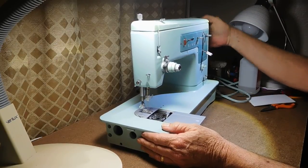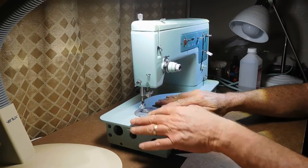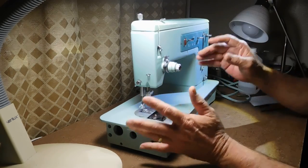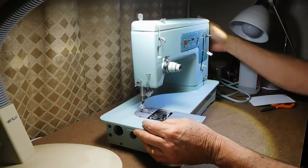The vertical oscillating hooks on the 301 have slide plates where you lift up and put a bobbin in and the hook goes back and forth. I've seen other models, not Singer, with a vertical oscillating hook where the bobbin case drops in. I've done dozens of machines with a horizontal rotary hook where the hook just goes around and around. But this was a first for me, so I'm excited. I downloaded the free instruction manual from SingerCo.com just to get an idea of how the machine is supposed to function.